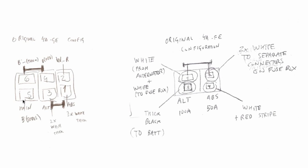In the absence of the main fuse, we have to short something or make a direct connection in this junction box here. It seems clear. So we have to understand a little bit the role of the main fuse. The main fuse is what feeds many of the car's smaller appliances. When I'm saying small appliances, I'm saying like the headlights, the stoplights. They are medium power currents, not small current like electronics.